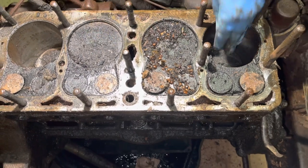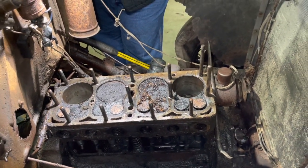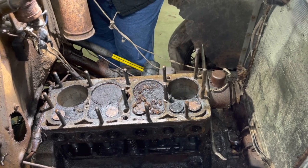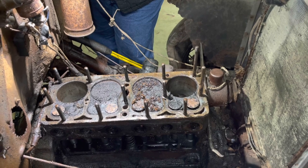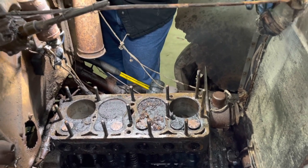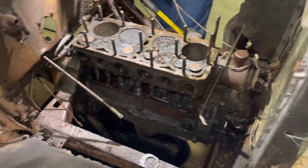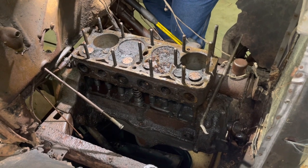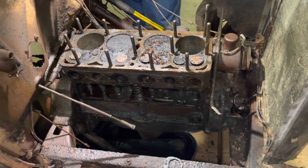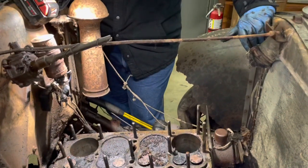These pistons are pretty well worn, or at least the rings are. There's a possibility that these rings could be stuck and they just need to expand back into the cylinder walls possibly. The other question is: is this motor similar to the Model T or the Fordson where as long as you can get a little bit of compression they'll still run? Mind you, we're just looking at refurbishing what's here to see if we can get it to pop smoke and do a little bit of running just to say we did. This is going to wrap things up for tonight - next video I suspect we'll do some cleaning, get the head gasket off, and try to get the valves working that are stuck.